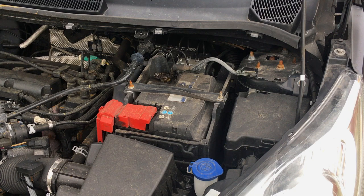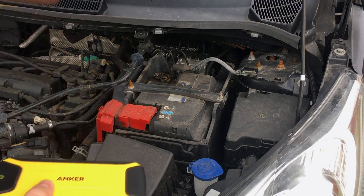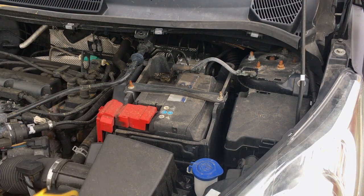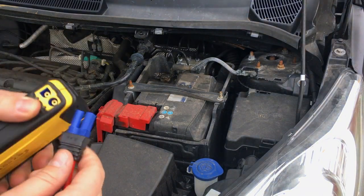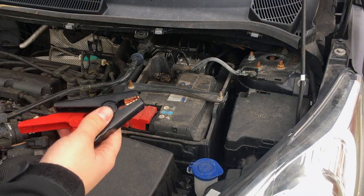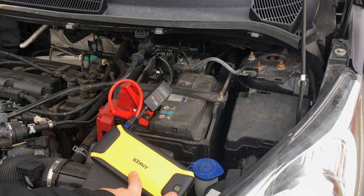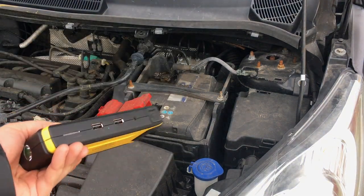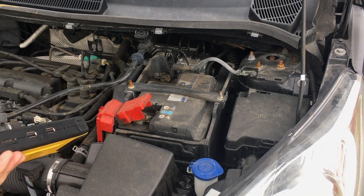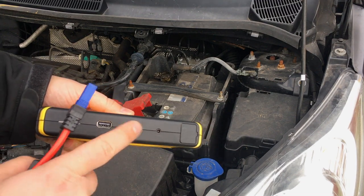What if your battery does fail? Well, you need some way of starting your car again. Jump leads are the most obvious choice, or someone can help you bump start the car. The one I like to keep in is a little tiny jump starter like this. These are great because the big packs we used to have — these do the exact same job. This can start this car about 10 times and they're very simple. You just keep it in the boot or your glove box. Connect the crocodile clips into the jump starter, connect it to your battery, push your power button, give it a few seconds to get a green light, and then we're good to go. These are especially great if you're stuck in an empty car park or side of the road where no one else is around — there's no one to help you start the car, so you can start it yourself. These are very vital to keep in your car, and additionally, you can also charge your mobile phone and tablets from the USB ports.